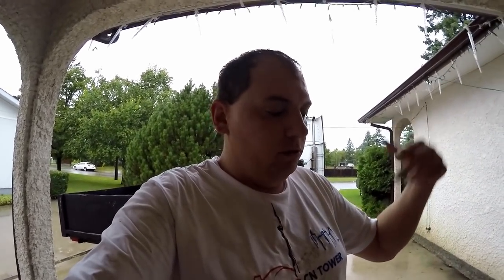She's looking pretty good and I'm very happy we were able to fix that air leak. But when I came home I discovered another problem — there was a squealing going on somewhere in the front. I checked it out and it was the belt tensioner; the bearings were shot on it. I guess when I washed it off really good, a little bit of grease or whatever was in there disappeared and it caused the bearing to go dry, so it was squealing pretty good.